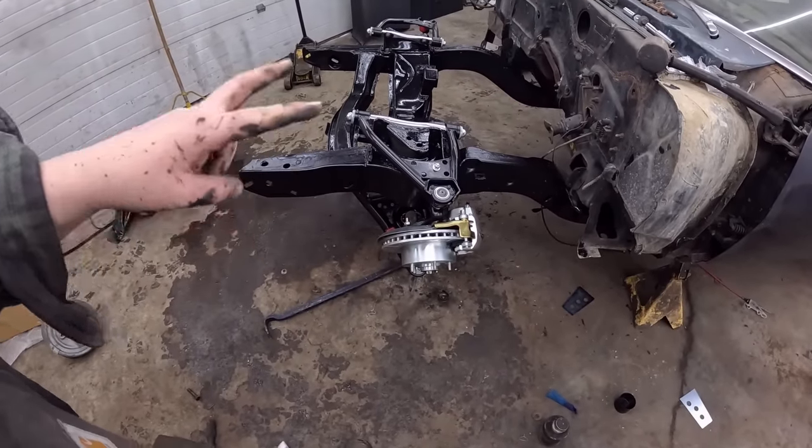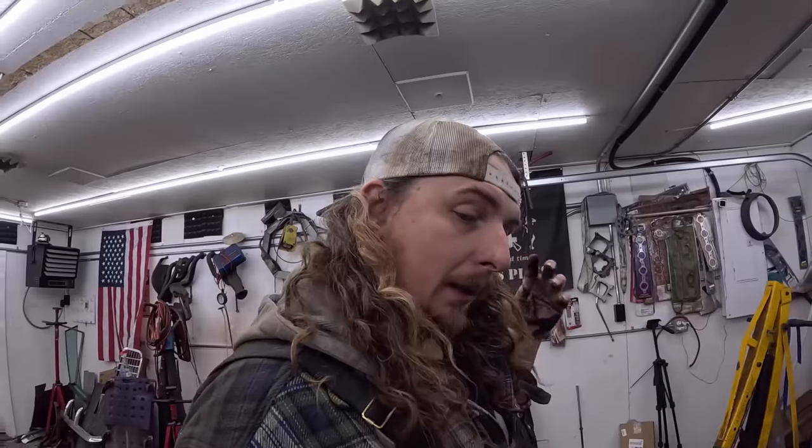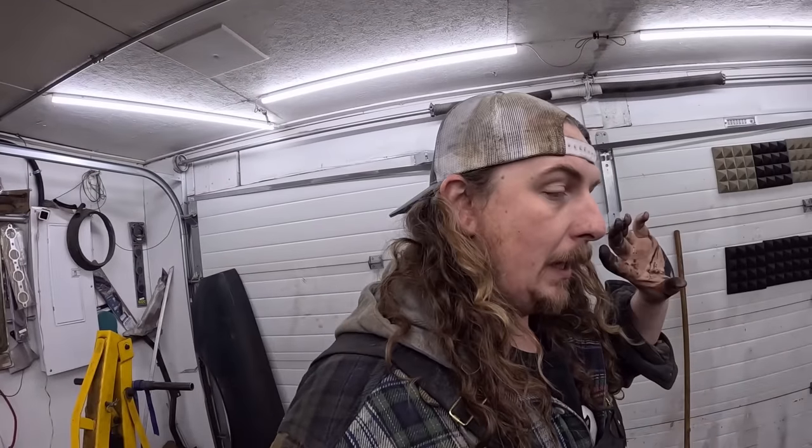The only two things that I found, you have to make sure you read the instructions, and I actually did, shockingly. The inner bearing, you have to test fit it on the spindle, because it's a really tight fit, it says, and you may have to emery cloth the spindle a little bit. I didn't, so just be aware of that. Because if you put that together and it doesn't want to go on, it gets all jammed, you're going to have all sorts of issues. The back seal was pretty good, it almost felt a little loose, but it went on there fine.